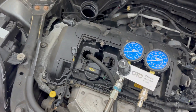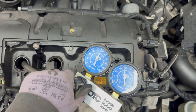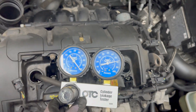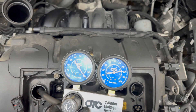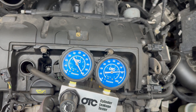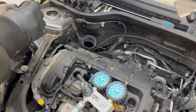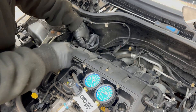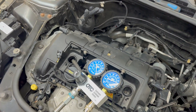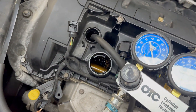Tool hooked up to cylinder number 1. If I increase the pressure, you can see the needles are moving together. It is at 80 kPa, so 20% loss — which I would still consider alarming, but it's a lot better than cylinder four. Let's put the glove on and see if it inflates the same way or not. It did inflate a tiny bit, which suggests the valves are leaking on that one as well, just a tiny bit. Also, if I take off the oil cap, the gauge deflates and I can hear air coming out from there.